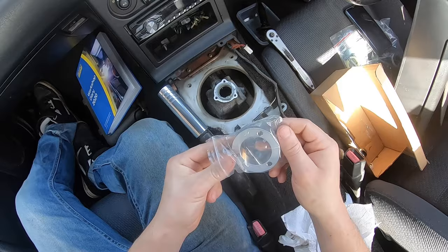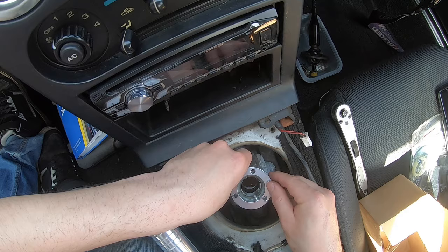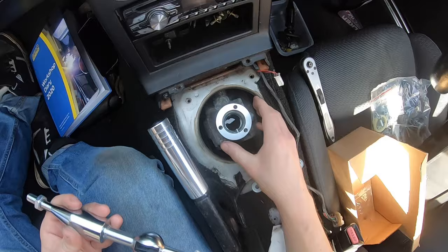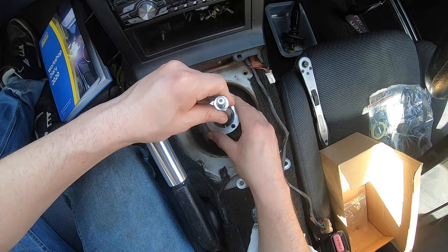Just want to drop it in, making sure that this little cutout here is opposite this one — nice and opposite. Because this new cutout slot drops into it, so it's all perfectly lined up, just like that. You want to get it to look like that, and you are ready for the next step. Once you've got it lined up, just get your short shifter, drop it in place like so — it literally slots into that little bit and it all lines up.